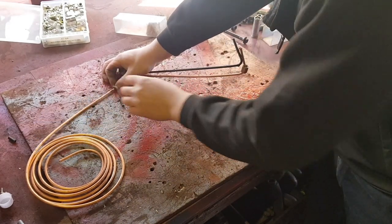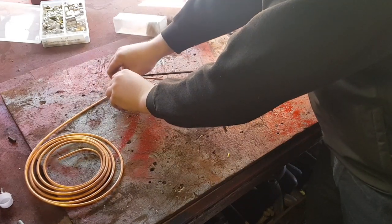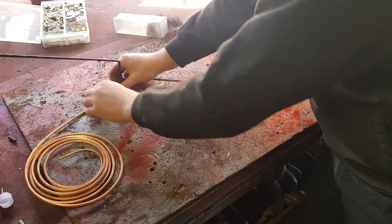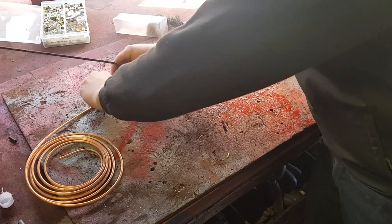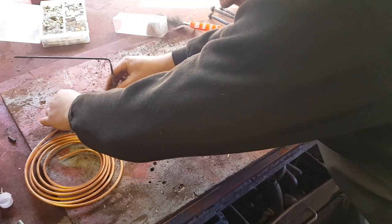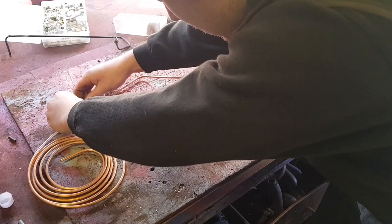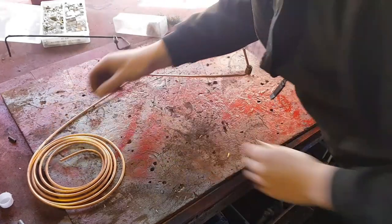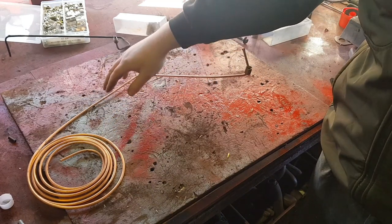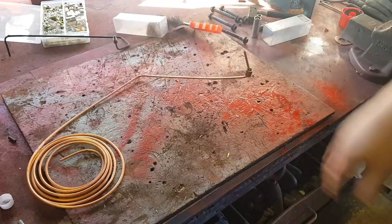So what I'm going to do now is, before I bend this pipe, I'm going to cut it. So all I do, that's where the bend is, put it up. If you follow it along, then you roughly know where you've got to cut it. So there. Screw or something just to mark it. So you can see the mark there, so I'm going to cut the pipe there, put the union on, flare the end, and then make the rest of the pipe.